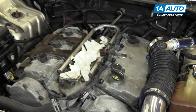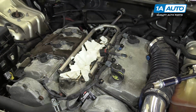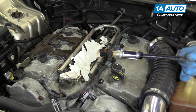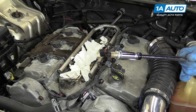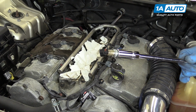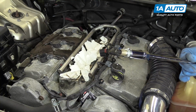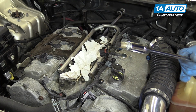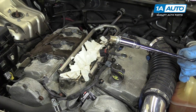Be sure to inspect each spark plug. We can see that this has the same condition. If the rest of our spark plugs look like this one, we know our engine is running too rich or is using more fuel than air as a whole. We're going to want to find out why that is. However, if all of our spark plugs look different, then we may be having different conditions on different cylinders or banks, and we'll want to see what's going on.